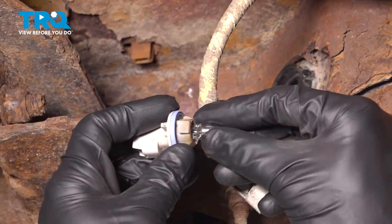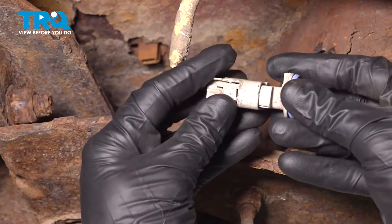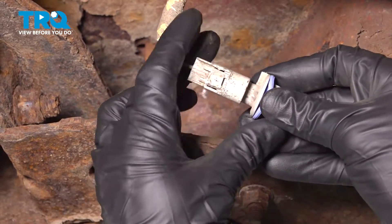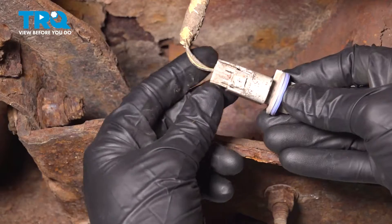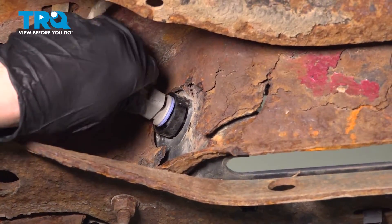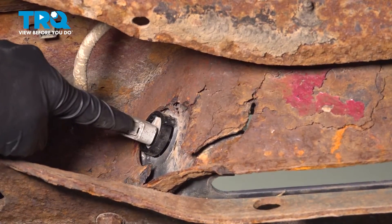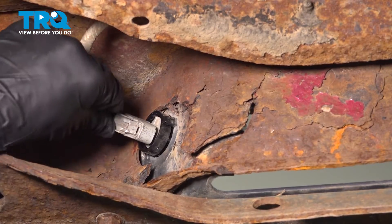Let's prepare for installation. Take your bulb and slide it into that bulb socket. After that, we'll be taking the bulb socket and the wiring harness and press the two together — listen for a click from that. Then take this and put it in place along the backside of the assembly, and twist it clockwise to lock it in. Give it a wiggle to make sure it's secured to the backside of your plate lamp assembly.